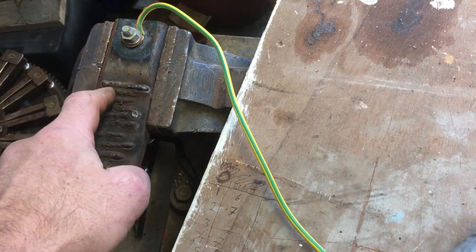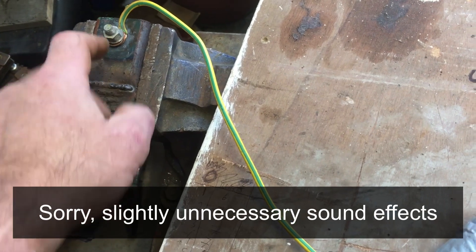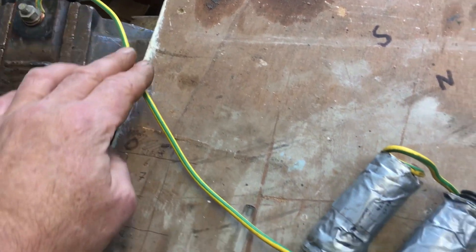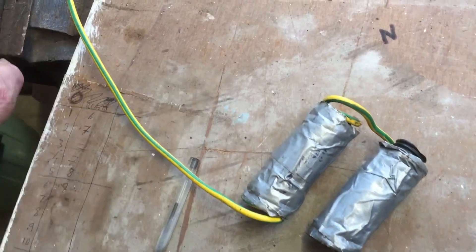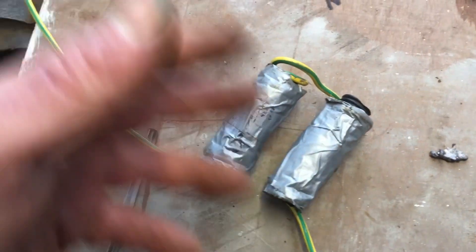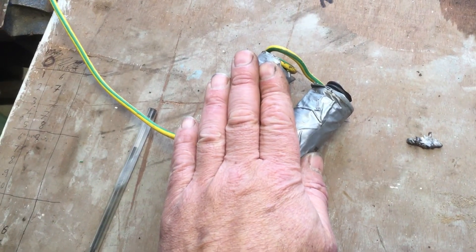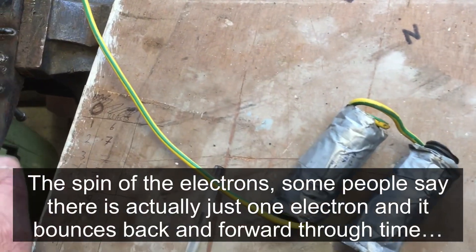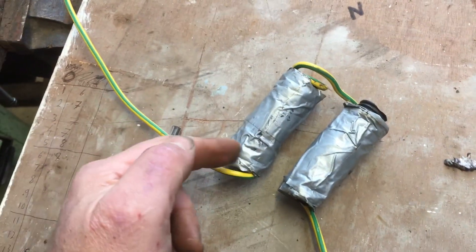It feels good. So I'm doing eight jabs, leaving a little gap at times because I am melting the insulation off this wire — this is something like 200-300 amps in here. I'm only putting 180 amps in, but it's the coils transferring that energy that really realigns the iron atoms at the surface of the magnets. So the positive side goes in here to the south — the magnet goes in like that.